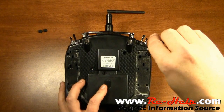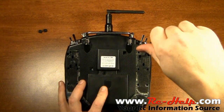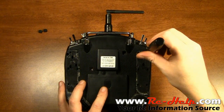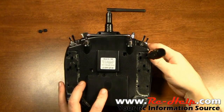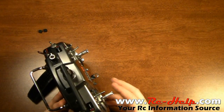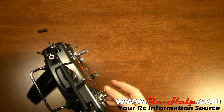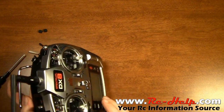If you're like me you may need to hunt for that little screw. Just start tightening it down and that's going to tighten the spring that's in there. Be careful — if you over tighten it, it may pop the spring. On mine I've got to go about ten turns, then come back and feel your stick. If it's a little too tight, just back that screw off a little bit and get the tension set right where you want it. That feels pretty good.